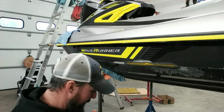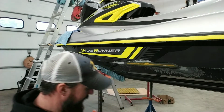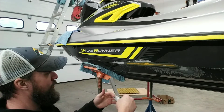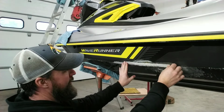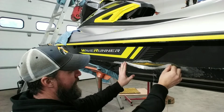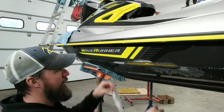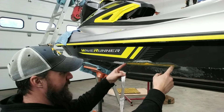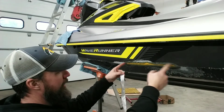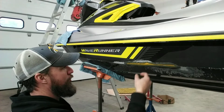So I cut up a bunch of strips here, and they're all going to be 1 inch. So you're going to think I'm just going to put it up here like this, right, and build this out. So that's not what I want to do. And the reason is you don't want to have all this fiberglass, basically, just going to be along this 15 inches, a long buildup of that thick in one spot.